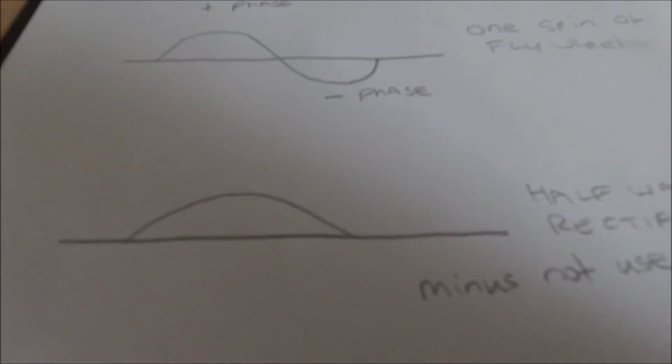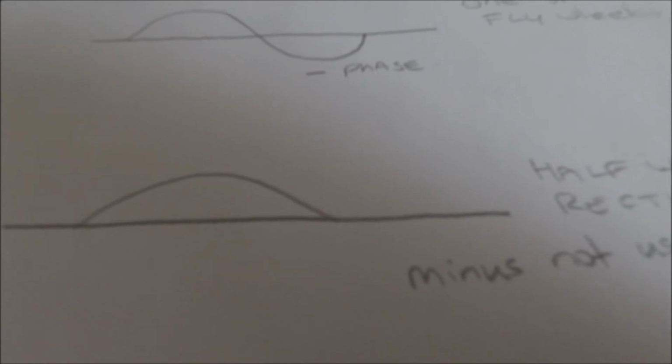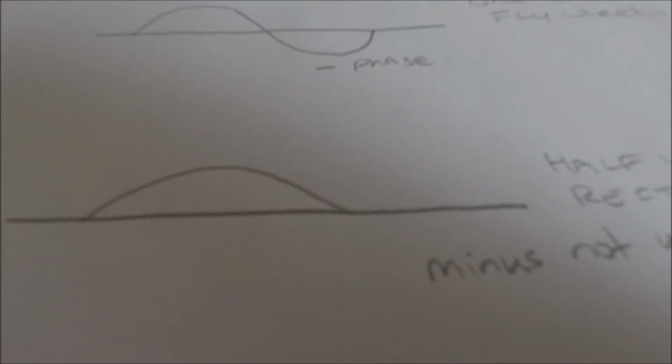It's in my opinion well worth doing, especially if you've got an LI or a system that already has a battery fitted to it, because you've already got the battery. You'll have the DC horn, the switches will work as they are with little or no adjustment to anything. So the output from the stator plate will go directly into the rectifier. The rectifier, when you've done a mod to the stator plate, will turn this cycle or one spin into just DC output. I will put a diagram in to try and explain a little bit more.